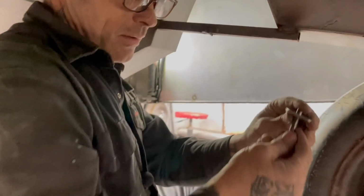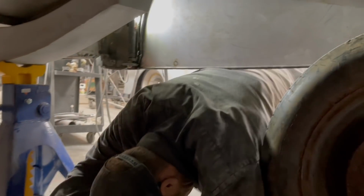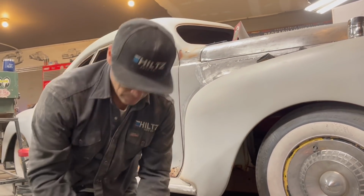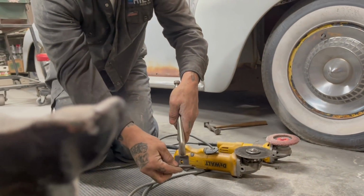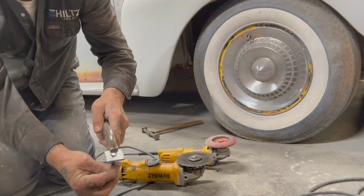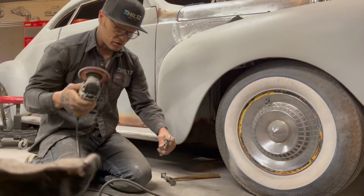What I'm gonna do though is, as I see the pin goes in, I've got a gap between the round rod down the bottom. So I'm gonna take this pin and bend it over a little bit and then weld it to that. And at the same time, I'm going to make the smallest part of it where it fits the tightest, I'm gonna make that closer. So, if you can picture it, round rod is running like this on that piece, because that's where I'm sticking that in on that fender. Round rod is running on that piece. You can see the distance that I have, that it's out. I don't want that. I want it closer like that. So when the pin goes in, the round rod is right there. I don't want the round rod back here in the pin. I want it tight as possible. What I'm gonna do is take some stuff off of this right now.